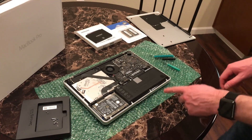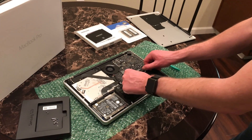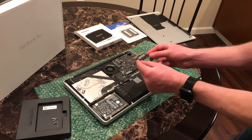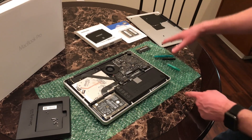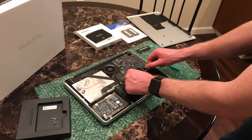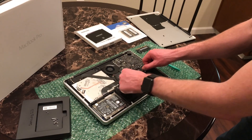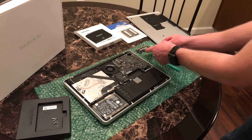Now I think we're going to do the memory first because it's a little bit easier. There are these little tabs right here — you just pull to the side and the first stick of memory will pop out. Pull it out and set it aside. Make sure you don't apply any static electricity to the memory as well, because you might want to save it or return it to the Apple Store. Just pull up on the tabs again, gently remove the second memory stick, and place it aside.